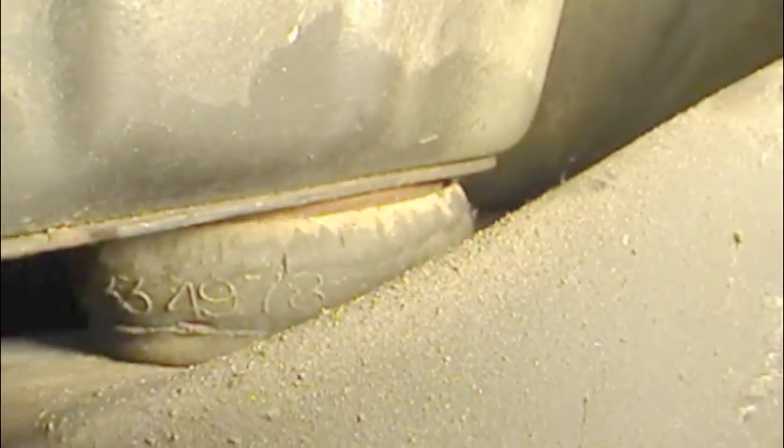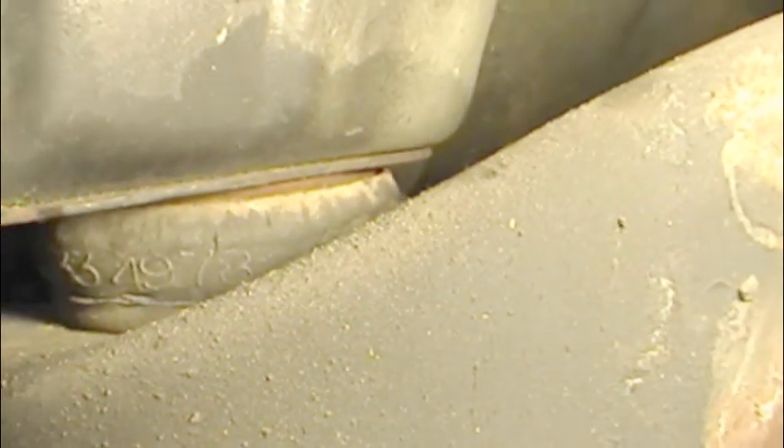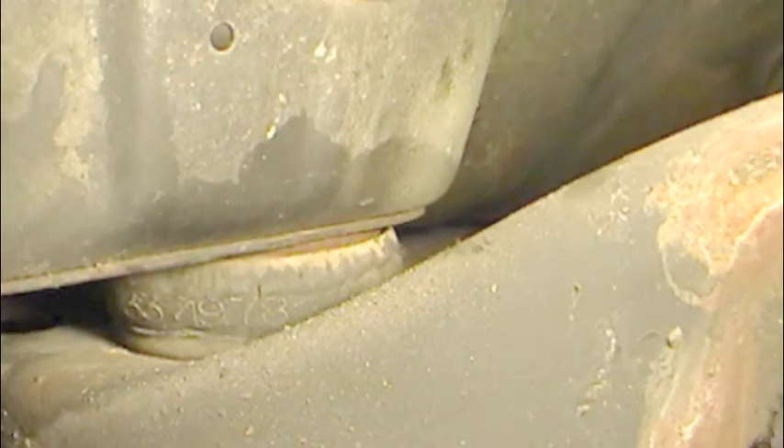I've already spun all these out in all 14 positions — actually 12. The front core support bushings have a nut and bolt; the other nuts per se are cage nuts in the welds of the body, which all came out in my example because this is a really clean car.